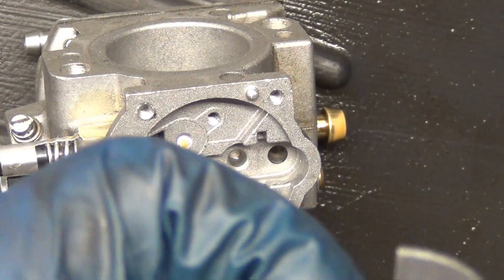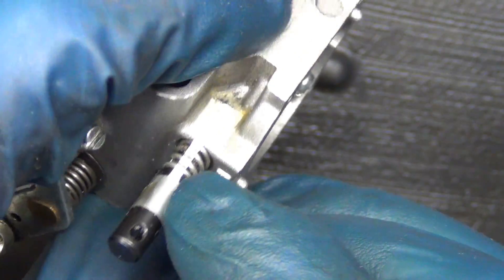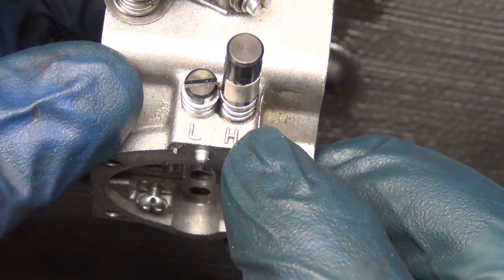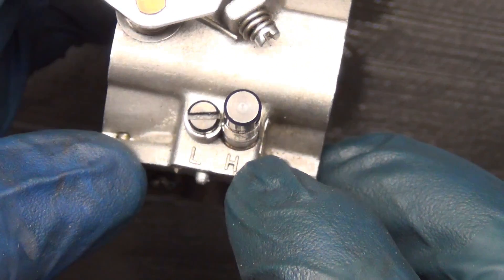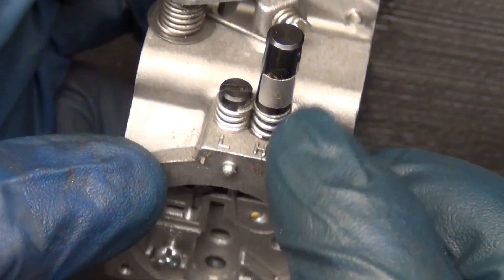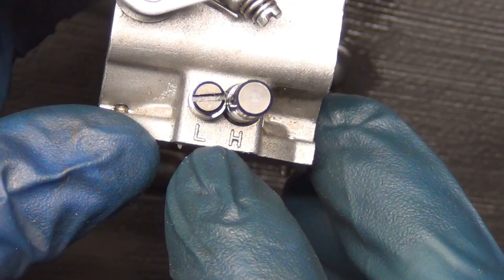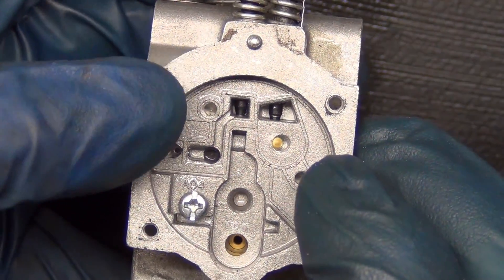Here you can see the two different jets. This one has kind of a metallic sticker, a tamper-resistant one — I believe this is the high jet, and as I look I can see the H right there. So it's better to have these be too rich than too lean. The reason being is you've got lubrication and everything — going too lean will wreck your motor. That's why they've got the sticker on that one. The low jet or the idle jet you can adjust as needed. The higher you go in altitude, the thinner the air is, and then you have to lean it out a little bit.